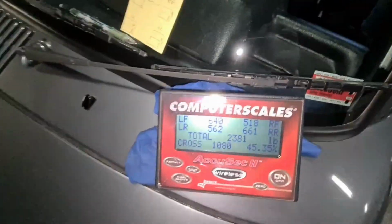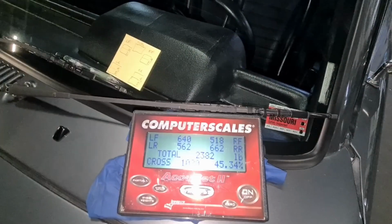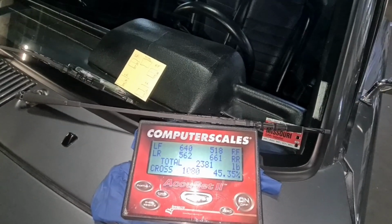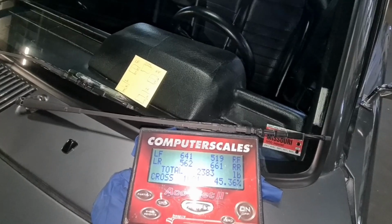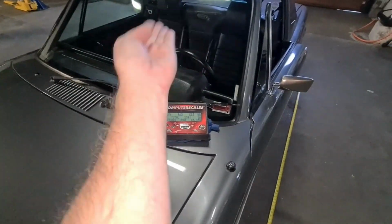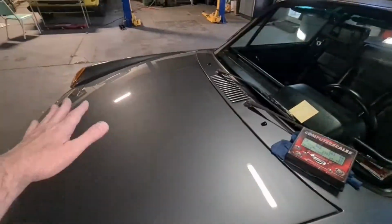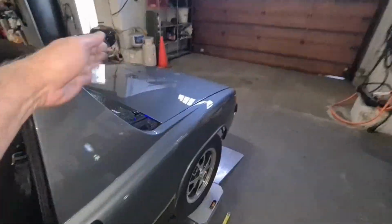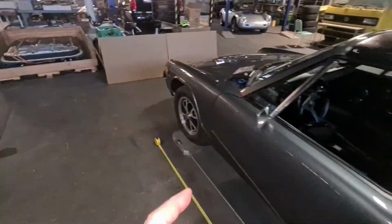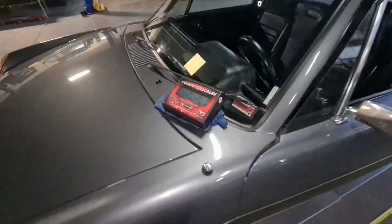Well, I didn't understand this before. It appears to be diagonally out of balance. In the front, the left side is 120 pounds heavier, but in the rear, it's 100 pounds heavier on the right side. And I don't get that. How can it be diagonally weighing like that? There's nothing in the car that does that, other than the steering mechanism is here. Everything else is symmetrical. The battery pack, the motor is directly in line. The rear battery pack, we've got weight pretty much evenly distributed across the back here. I don't get it. But I tested the scale before. I stood on each one, and it gave a reading for that corner within a pound or two of the other ones. So this is just what we're left with.